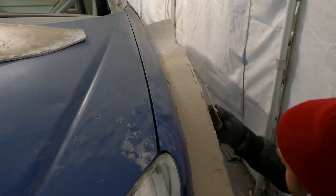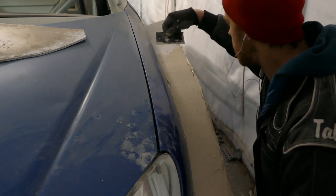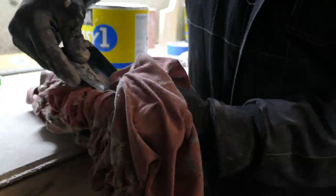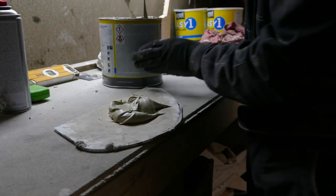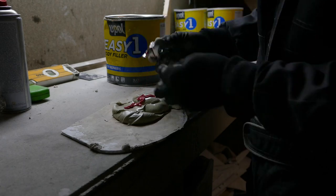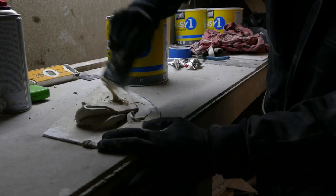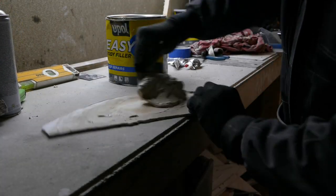The light broke on the front part, so the light isn't very good at the moment. When you're using filler, always clean off your tools because when it dries out it's quite hard to get off. When you're mixing filler the hardener is red, so you just want to get a nice smooth consistent color - if you see streaks or lines in the filler you need to keep mixing. But obviously it's a ticking time bomb - as soon as you start mixing you have a limited amount of time to get it on the car before it dries up.